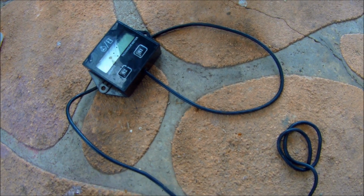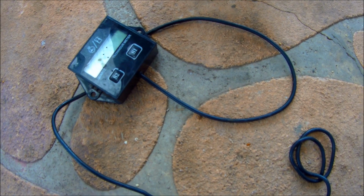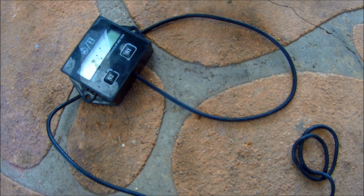I also think on these new bikes, especially for somebody just buying the bike, a tacho is a really good idea, and the ideal running-in speed on this bike is 3,000 revs, and it's easy to pick up on these bikes using this tacho, and it's a very simple thing to install. And after you finish running the bike in, you can just take it off. Like I said, it's about a 5-minute install, and once that's done, you get the ideal running revs, which is 3,000.